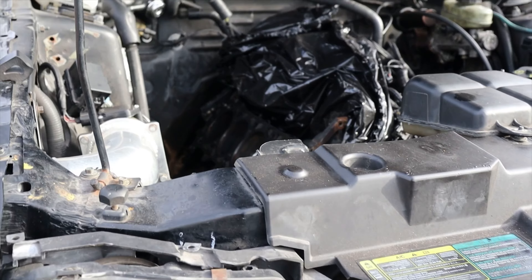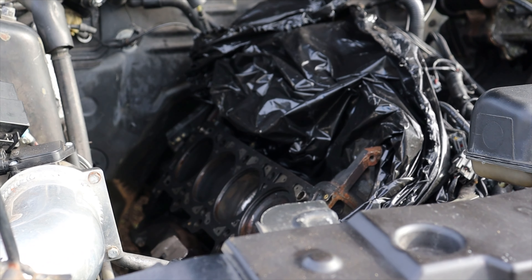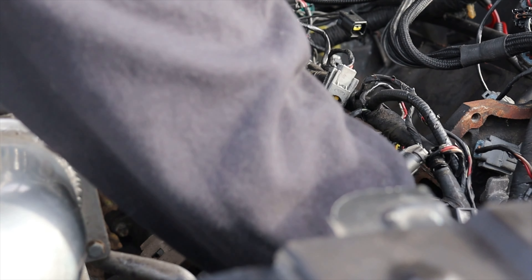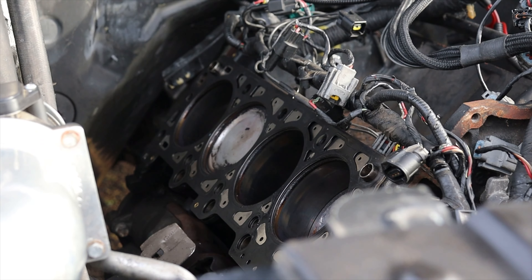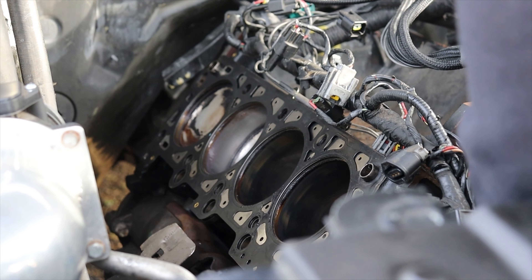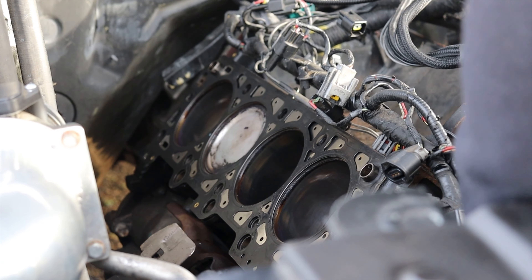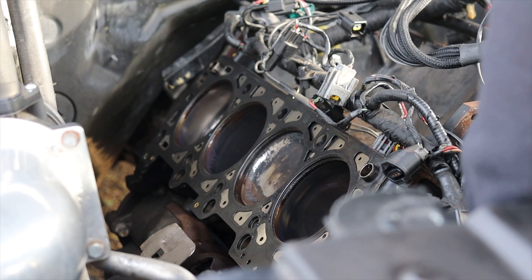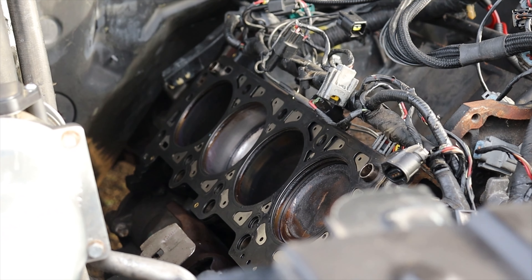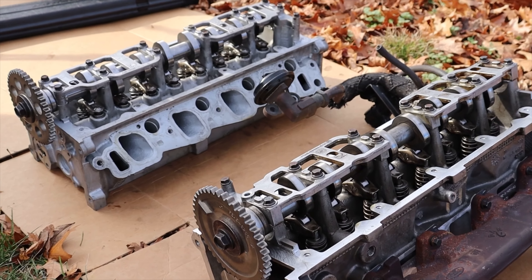There you go — dowel pins in this time and the head gasket's on. I'm not gonna record everything but most of the stuff. Probably see you guys when I pick up the head and put it on the block. I'm just gonna show you guys that the engine's not locked. As you can see, yeah, it's not locked. So now I'm gonna throw the head on.